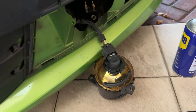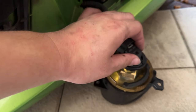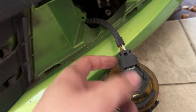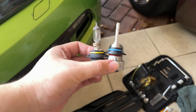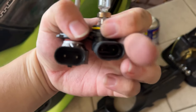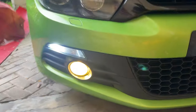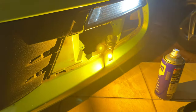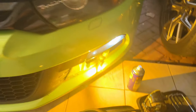So after unscrewing the screws, you just need to twist this bulb anti-clockwise. Once you twist it, you can just take it out. Once you're done taking it out, you can just unclip the connector and then pop in the new bulb. Let me show you guys the bulbs — the right one is the LED and the left one is the halogen. You see the connector right here. All snaps in place. Plug and play. You can see this is the halogen one, and this is the yellow fog lamp LED. Pretty big difference in terms of brightness.